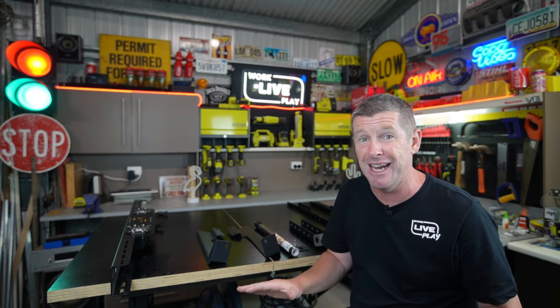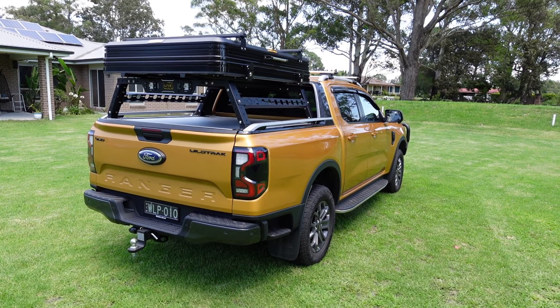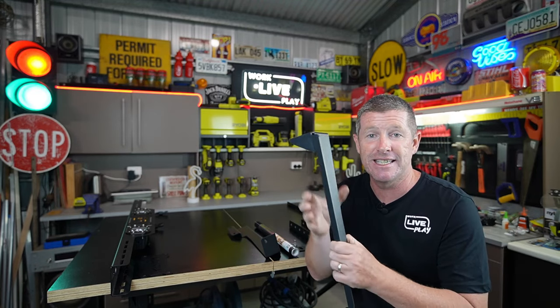You need to work out what the load rating is of the tub or the roller shutter you're trying to fit the tub rack onto. Now if you've got a Next-Gen Ranger, Ford really should do this from the factory. But if you're putting extra load on top of the tub — whether that be a tub rack, a canopy, a rooftop tent, anything like that — you need to buy a J-Brace kit.